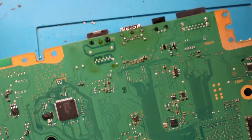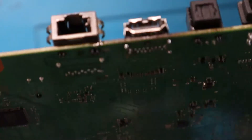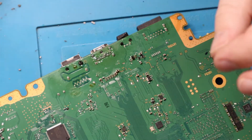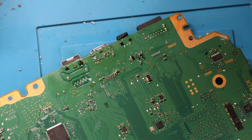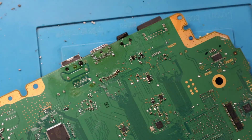Alright so I have the new port soldered in and had a little bit of trouble with it. I don't know if I burned a pad off when I was removing it or maybe whenever I was putting it back on, but one of these pins down here has just a slight wobble and I cannot seem to get it to stick to the ring on the back side of the motherboard. I've done my best — it's sticking for this moment. So I think what I'm going to do is roughly put this thing back together and get it tested and see if that's going to cause an issue, wiggle it around. I'd rather do it now with it halfway put back together than me finishing the whole thing and then it tears up on me in two or three weeks whenever I'm playing it.